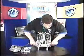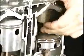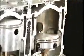As the piston moves down, the fuel, air, and oil transfer up into the combustion chamber, where it will lubricate the combustion chamber. Any remaining oil will get burnt up with the fuel and air and spit out the exhaust port.